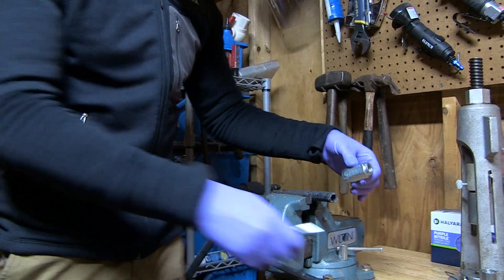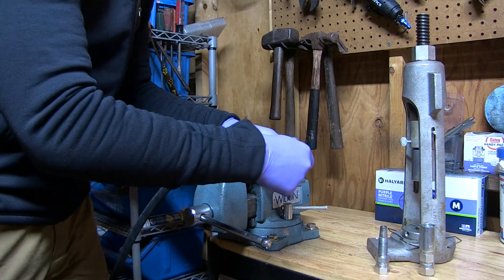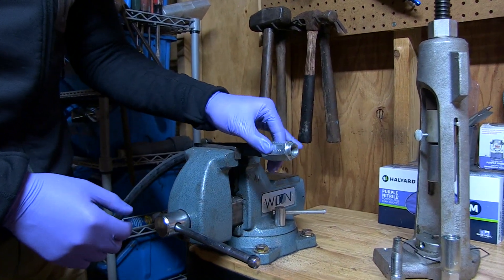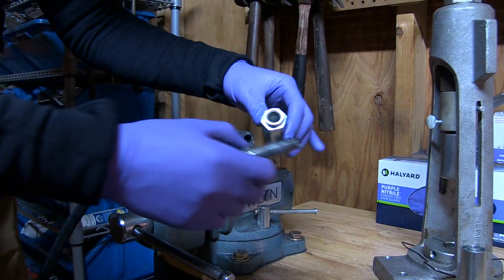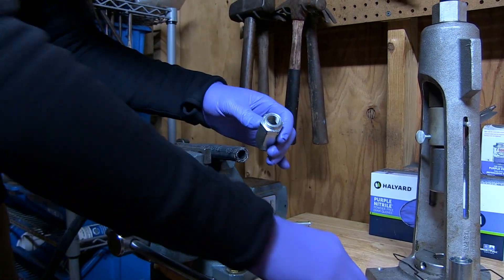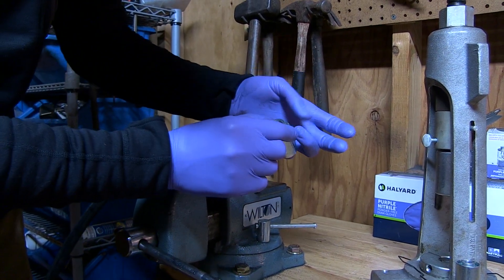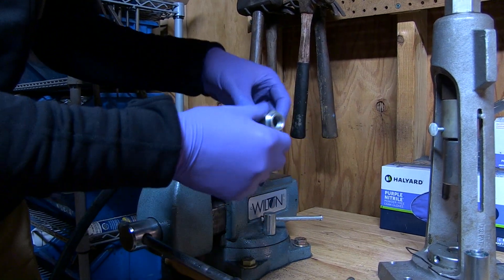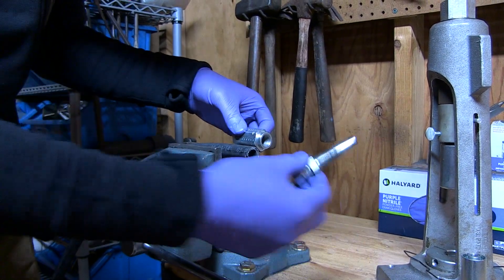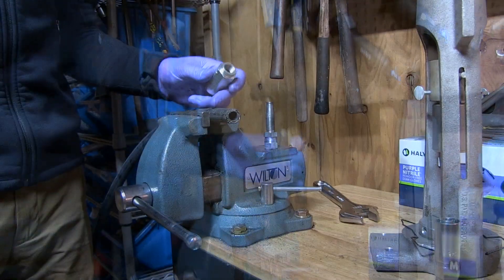The trick to these is — you're going to think righty-tighty, you're going to think you put it on and tighten it like this. No. It's reverse threading. So you're going to go counterclockwise, and then once it bottoms out you grab the second piece. You're going to want the end of the hose right at the end of the fitting. Once you can't turn it anymore, you know that part is done, and that's when the outer piece comes in. I'll grab my tools and show you guys how to properly install this.